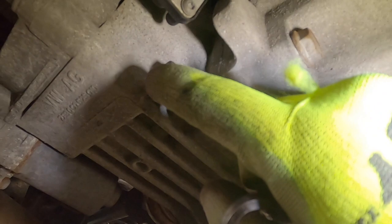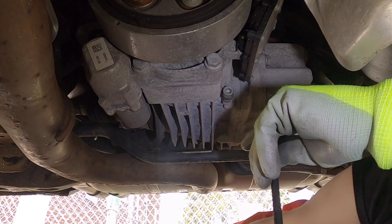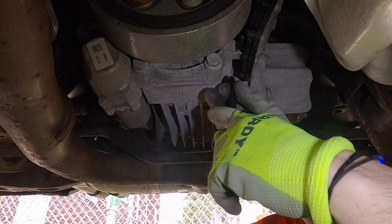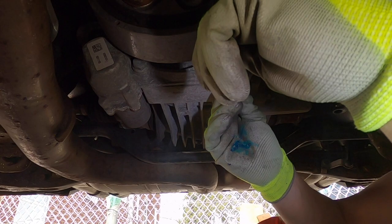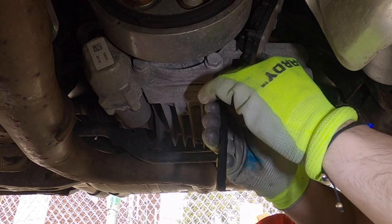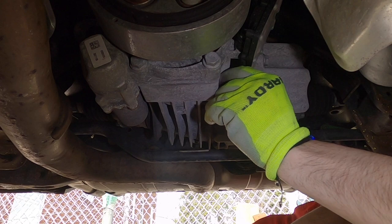You're going to need a little spill pan to catch the fluid, and just be aware that this stuff smells really really bad. The fill is completely loose but not out yet. This is going to be the drain — eight millimeter. There we go, it shouldn't be on too tight. We're going to drain this out. The kit linked in the description comes with all new screws, gaskets, and o-rings.